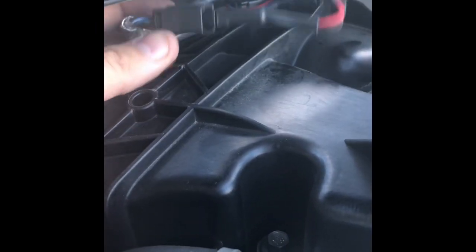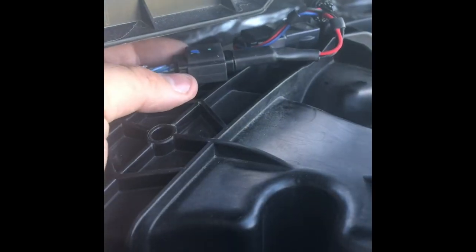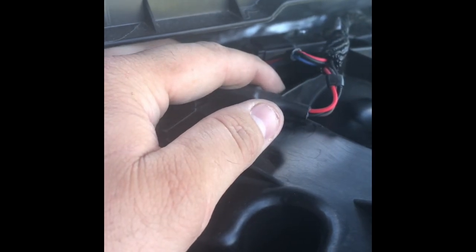Okay guys, the manifold air pressure sensor is done. It was easy as a click. You push in with your knife, screwdriver, whatever, on this little tab right here. This is mounted this way. You push in from the outside and pull back, and you just simply put their connections in right there. They popped right in. I'm sure these are OEM connectors. They literally slid right in.